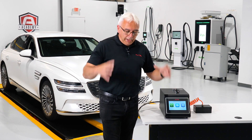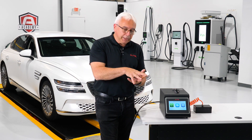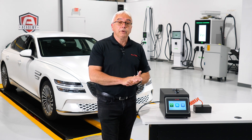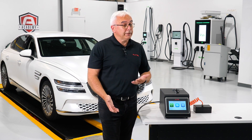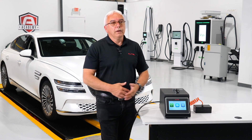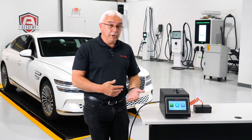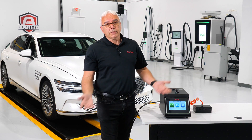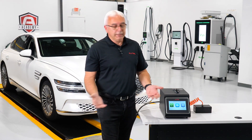The actual battery enclosure itself is usually just two pieces of tin or metal bolted together with a small layer of some RTV-like substance. It's not uncommon for those seals to fail and degrade whether or not the vehicle is ever in an accident. If you remember, there was a hurricane a couple years ago down in Fort Myers, Florida, and that's what drew the attention of the federal government to actually want to mandate a test like this. All those vehicles experiencing fires as a result of the battery enclosures — most of them were never in any type of accident. It's just that over time, as we all know as technicians, RTV has a tendency to fail.